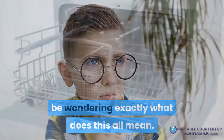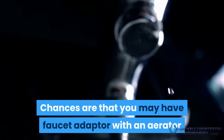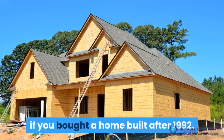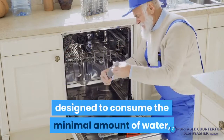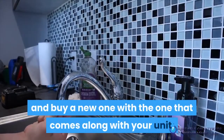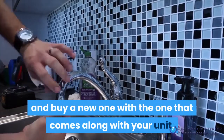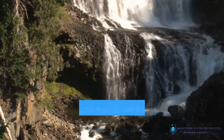Well, this will depend on your dishwasher. Chances are you may have a faucet adapter with an aerator if you bought a home built after 1992. However, many of today's dishwashers are designed to consume a minimal amount of water, so you might have to remove the adapter and buy a new one that comes along with your unit. If you install the wrong adapter, you risk potentially damaging your unit because you could be limiting the mandatory flow of water.